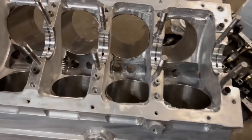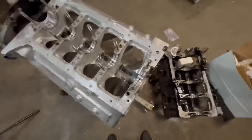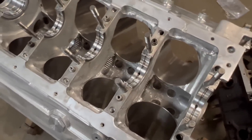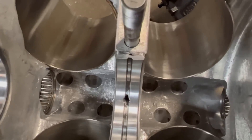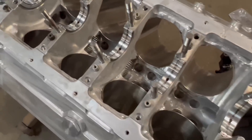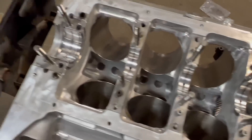On these bearings, the hole is small but it's wing-shaped, so it's actually bigger than the hole itself — that's going to work out good and I don't have to do anything to the actual bearings. Something you always want to check: make sure these are 30 thousandths undersized, and make sure all bearings are correct because sometimes they're packaged incorrectly. I'm not a big fan of spacer bearings, but people have been doing it forever and this motor has been together two years without an issue.